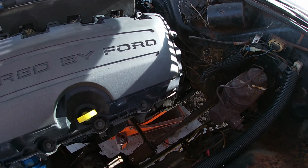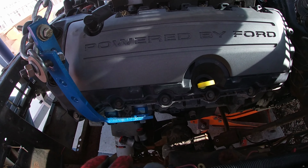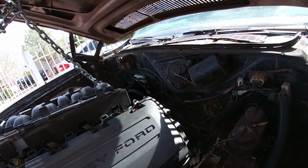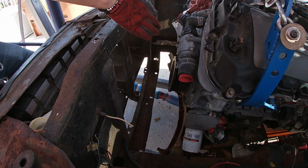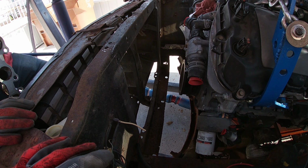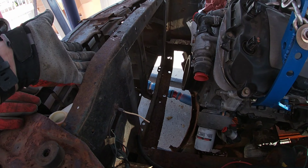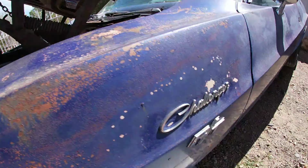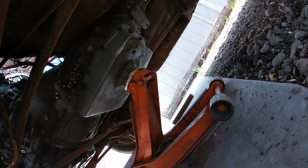Anyways, now we know really what we need to do as far as the suspension underneath to get the engine in here. Definitely I would want to have it about 4 inches further back. Even at this point, we have room for a radiator and slim fan, maybe. You can always put the fan on the front, but I really would want the engine further back.